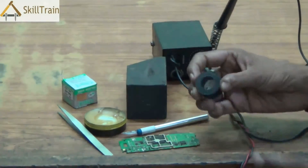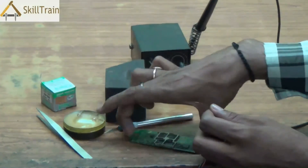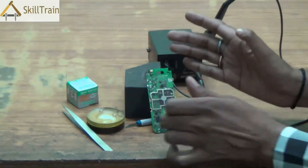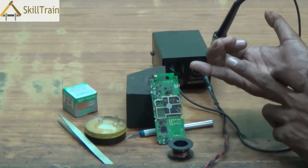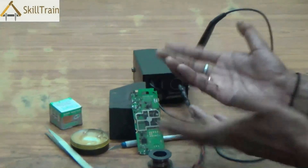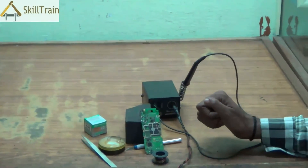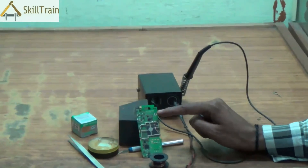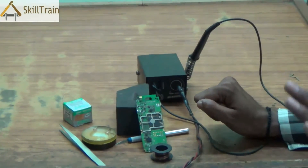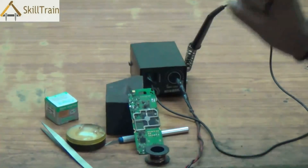These two points are very critical when working with a soldering iron. While using the jumper wire, you need to be clear on where you need to place it. Unless you are aware of where the jumper wire needs to be placed, do not try and connect points onto the mobile PCB. It is primarily for network fault, SIM fault, or internal connectivity-related faults where a circuit is broken that you need to use a jumper wire. Please ensure that you look at the respective circuit diagram of the mobile phone before attempting to place any jumper wire on the printed circuit board.